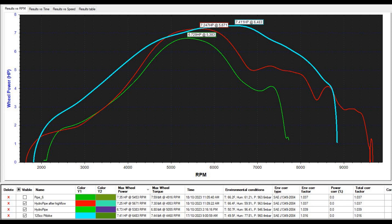The red curve was after we high flowed that carb and re-jetted again. It's still a bit rich up top — you can see those small dips, that's when it started four-stroking. But I think we're well beyond what this little Bowfeng carb can flow. We had a few people saying these numbers were bogus — show me your engineering degree.